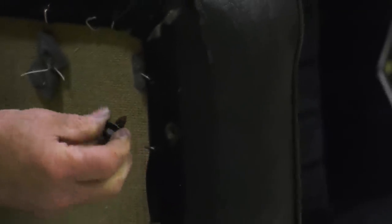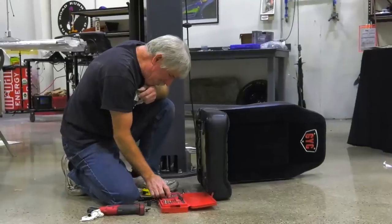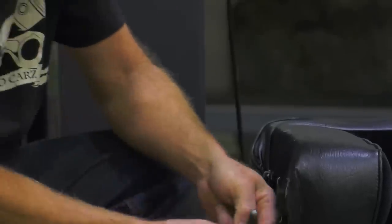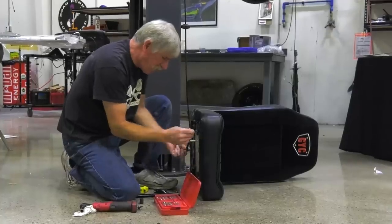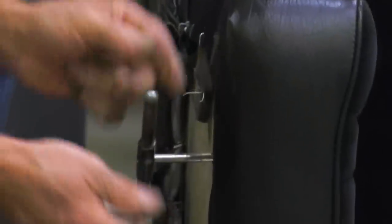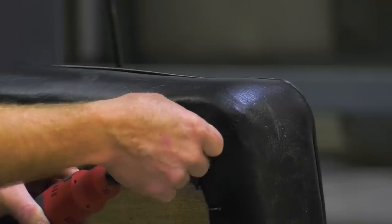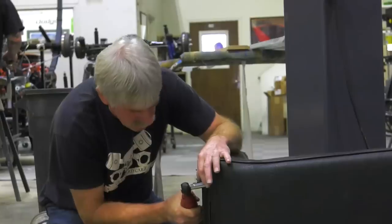One of the things I admire most about Doug is how he will take his time. When a bolt doesn't thread in by hand, he'll clean it up, clean the bolt up, run a thread chaser through it, run the tap in there — get those threads all cleaned up. Most technicians aren't this way; they'll just ram it in with an impact gun. Doug takes his time and makes sure it's a sanitary install. For all the crap I give him about his weirdness and his mannequins, he's actually a phenomenal tech.